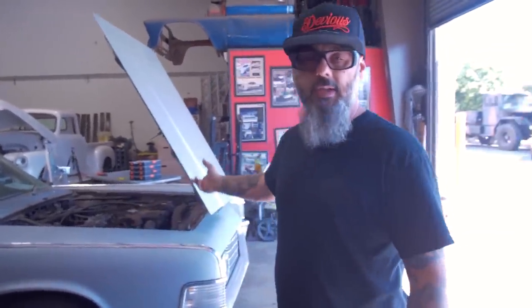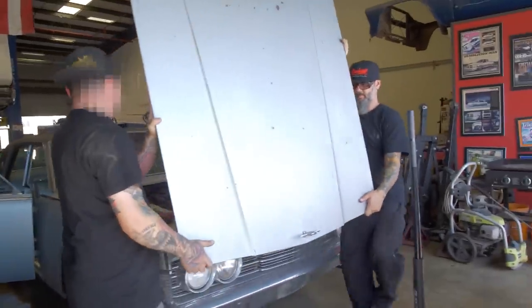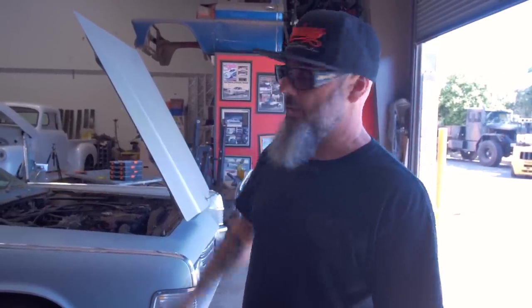It's finally time. I got all the guys together, a good group of people. We're all going to clock in right now. The first thing we'll do is take the hood off, start draining all the fluids in the motor, get the motor and tranny out. We're going to take all the interior out, door panels, and start taking all the chrome off the outside — bumpers, grill, trim, door handles, vinyl top, and all the windows as well. Hopefully by the end of today we'll have a completely stripped car and a happy customer.